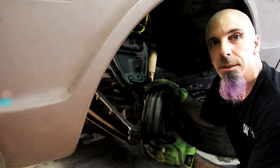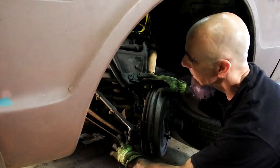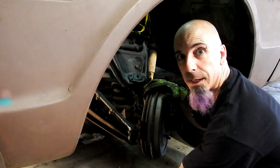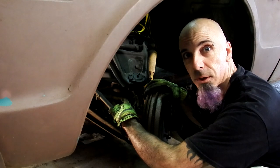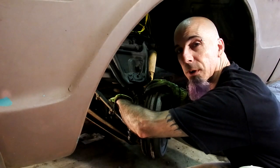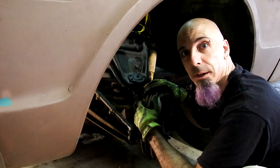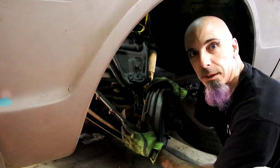So the front here, I'm going to have to disconnect either the upper ball joint or the lower ball joint. Just need to basically get these separated and then we'll go ahead and put a jack under this. We'll lower this down very gently. You may want to use a spring compressor because it's very dangerous if any of these things go flying. And then once we lower this down, that spring will basically let go. We'll put the other one in, make sure it's clocked correctly, and then put it back in, jack it back up, reconnect it and that's it.